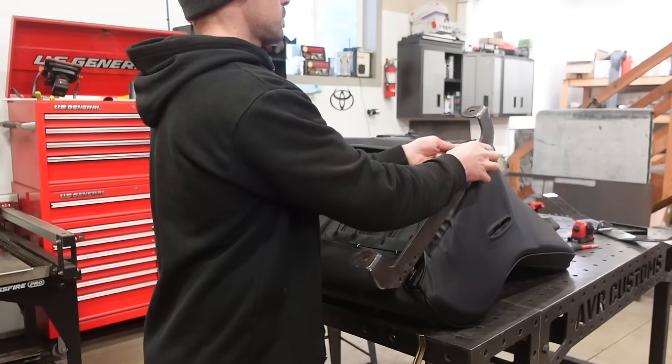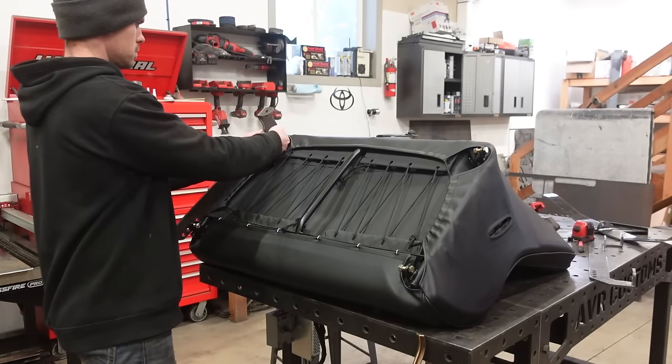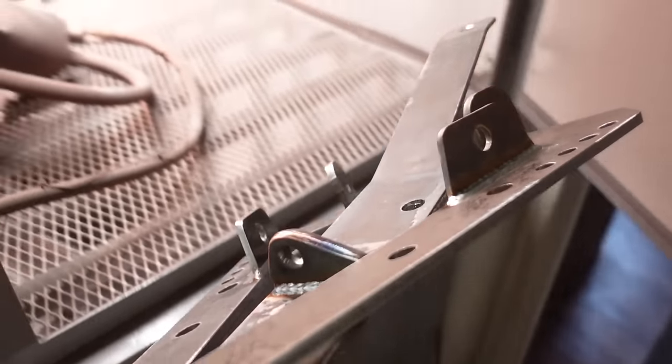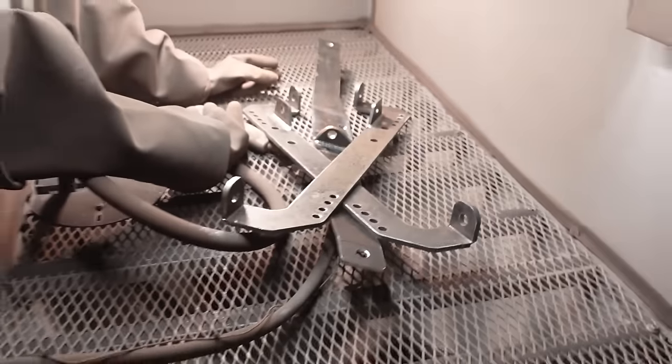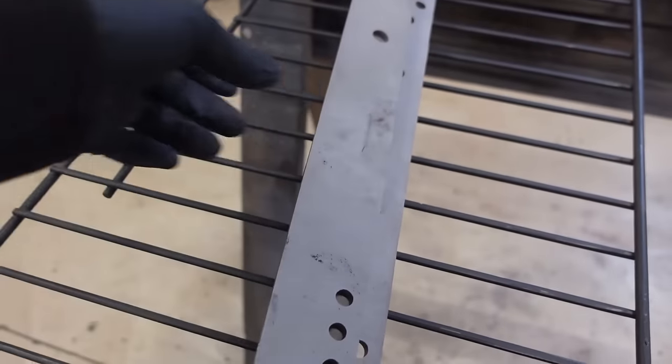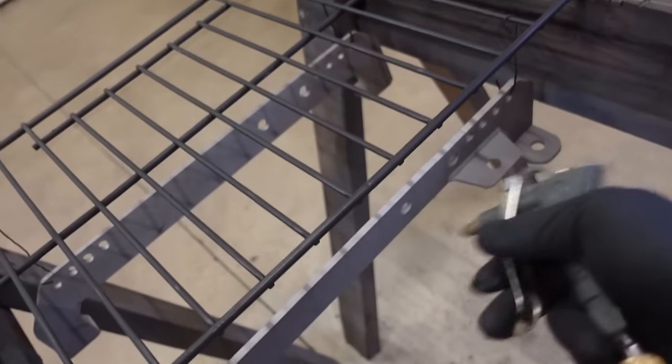It should be fun. Well, if you guys wanna get into powder coating but haven't yet because of the price tag to get started, I got some ideas for you. So I use a regular household oven. I got this thing on Facebook. It was like $60. It works great for smaller stuff. Obviously, you're not gonna fit a whole bumper or something in here, but it works great for the smaller parts I usually do. So that is a huge savings.